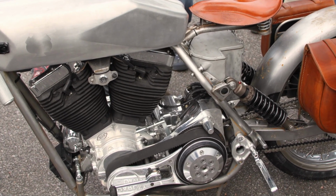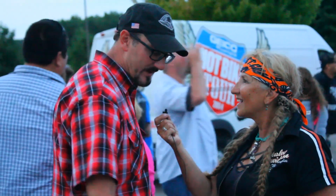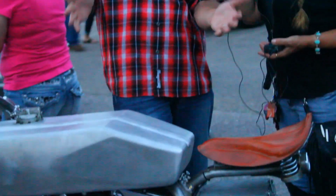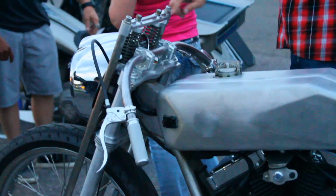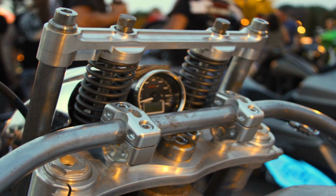Oh, my goodness. How did you keep it on the road? Well, that's the beauty of it, just these two little wheels and what's going on. This thing was a hoot to ride. Everybody's like, man, it can't be comfortable, but this old reproduction race seat, the shocks are off a 250 Ninja because when you extend the swing arm, there's too much leverage on them. The front fork is made out of a KX 125. My friend Jeremy Cupp at LC Fab fabricated that hydro springer, so the springs are exposed, but the tubes have nothing in them, it's just the hydro.